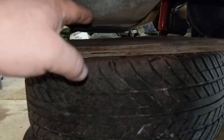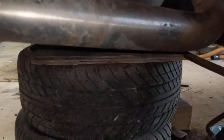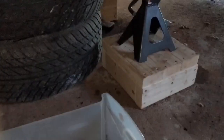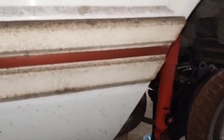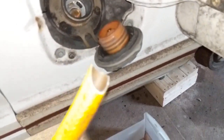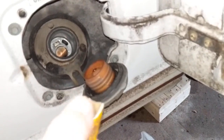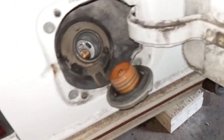Basically, you got to get the hose below the gas tank. You got to get it so you can start to siphon it. Once it starts to siphon, it should come out. So I'm going to go ahead and get that set up and show you how I do that. Alright, so go ahead and cut the end of your hose. Cut it like at a 45-degree angle or whatever. That's so it doesn't stick to the bottom of the tank, and then you won't be able to siphon.